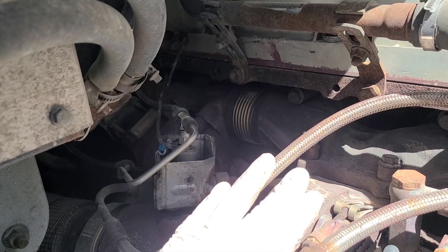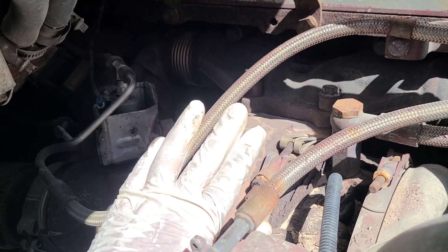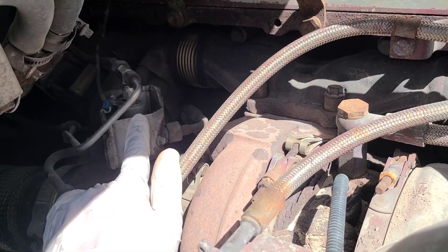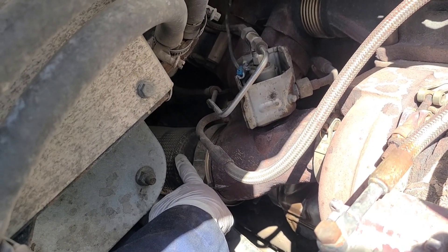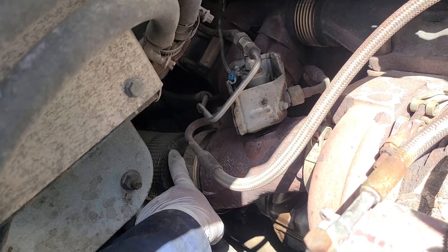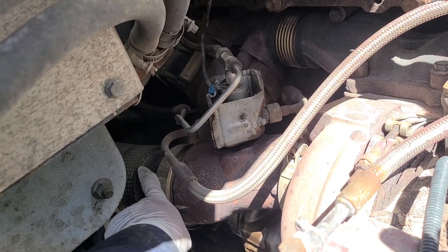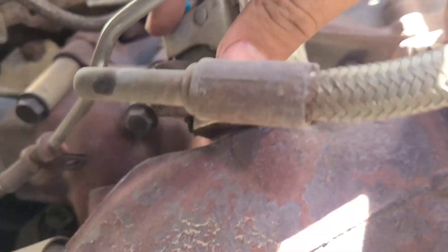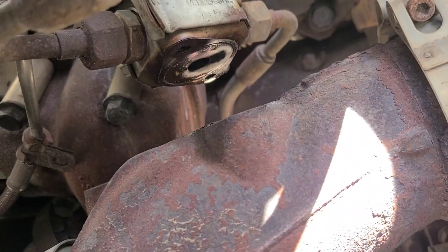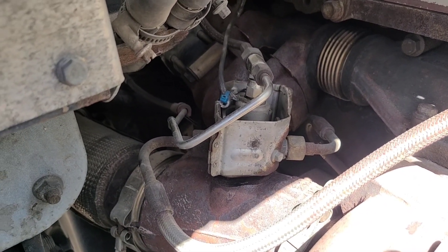What'll happen is it'll come out so hot, this will spray a mist in there and literally start a fire in this pipe. That's why it's got this crazy insulation on it. It's hard to aim the camera with the sun right on the screen. This basically becomes a flamethrower, and right past this is your particulate filter - that's what we try to burn the soot off of. This valve gets all kinds of gunk under it. I didn't even have to take any of the lines loose - just two bolts. The coolant lines, the fuel line, and the electrical circuit are all left intact.